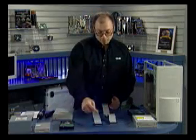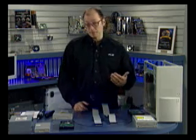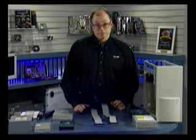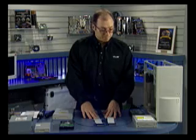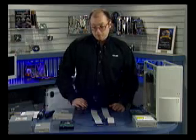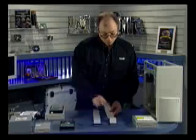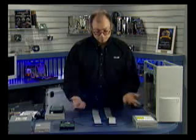That sounds strange but that's the way it works. If I was going to add a fourth device — a second hard drive — I would add that as the secondary slave device. So that's how four drives should be installed, all set to cable select using two 80-conductor cables. For the actual system build here, I'm just going to install two drives — one hard drive and one CD-RW — each on a separate cable, with the slave connectors unused.